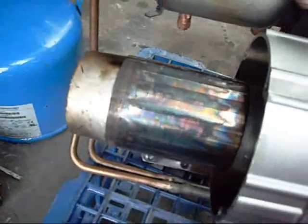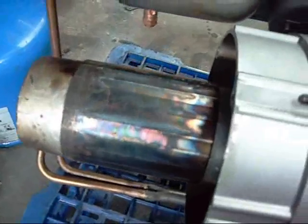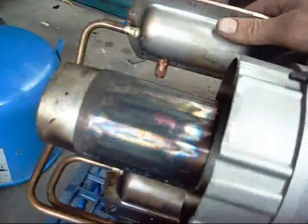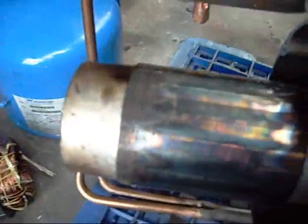Because the motor's rotor was stationary, it acted like an induction heater. It actually heated the motor stator up. That's not from the burning of the windings — that's the heat that was induced in the stator or the rotor. I noticed that early on: the first time it locked up I poured coolant down it and it started boiling, not on the stator itself but on the rotor. So it acts as an induction heater.